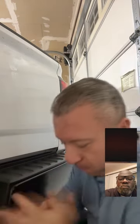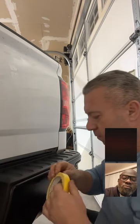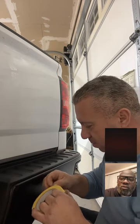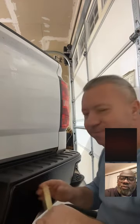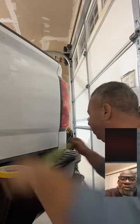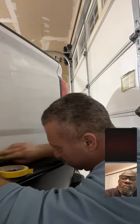The difference with the Prepsol is that it actually has a very small percentage of a degreaser in it. Yes. This is one I have had guys ask me: why do you cut your IPA and not use it straight? The reason is that if you use IPA straight, it evaporates too fast and replaces the dirt back on the panel. Correct. By putting the water in there, you're cutting down that reaction time. You're giving yourself work time. Exactly, and that's just it.